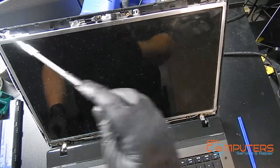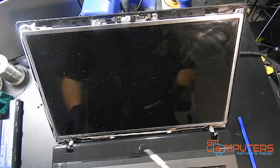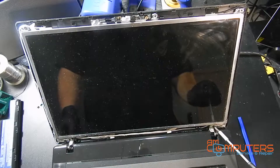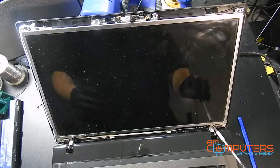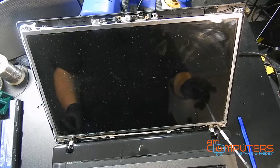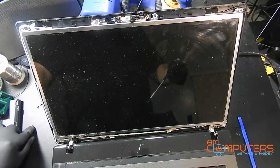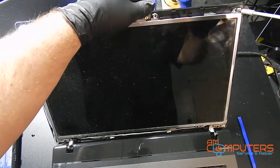So now there are two screws up there holding the hinge in at the top, and then we're also going to take these two screws down here, so we can dislodge the hinge completely to actually get this back bezel off, so that we can get to the screen a little bit better. Sometimes that's not necessary if you can just pry gently and lift and get enough room to get your screwdriver in. But since this is a bigger laptop and everything's a little bit further apart, I don't want the weight of possibly the screen to break the plastic anchors.